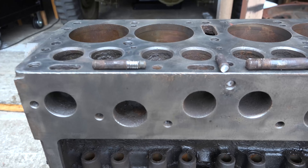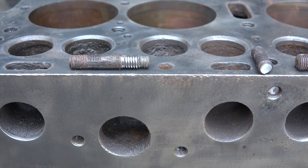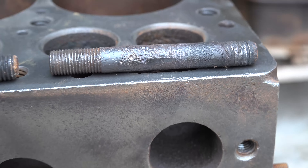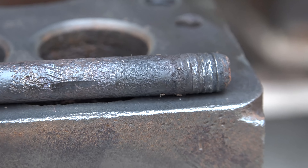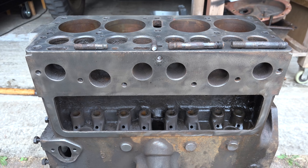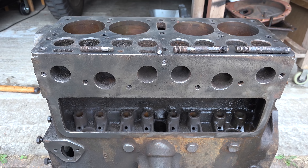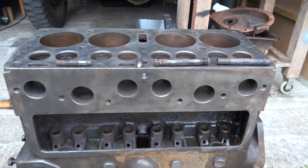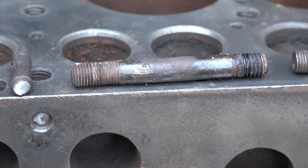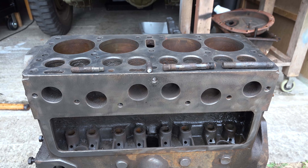You can see the difference in how the studs come out. Look at this one - the stud thread on that is all good and then just at the end it's corroded in, completely eaten away. There's the broken one. And here's a normal thread on this head stud compared to the bad one where it's completely eroded and corroded. That is what happens - you can go from good threads to threads which are completely messed up all in the same engine. That magic stud remover is just amazing - it really makes removing them quite easy. The amount of force you can put through those surfaces is unbelievable. Heat, WD-40 and the special stud remover makes light work of taking these things apart.